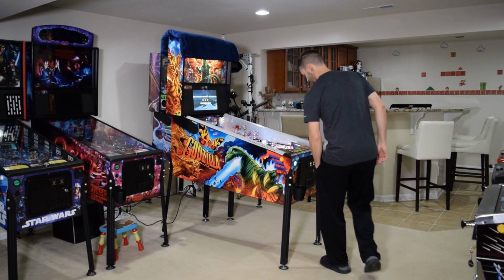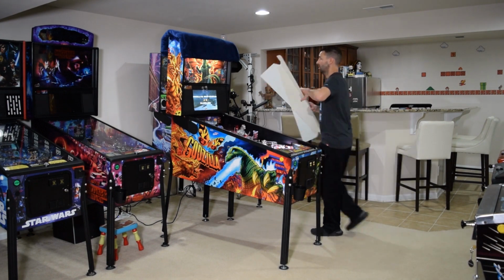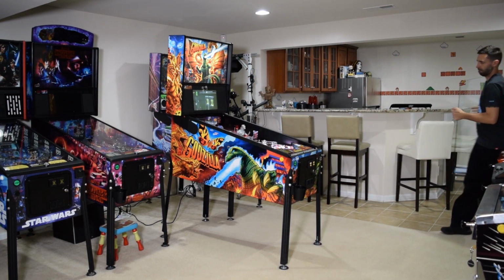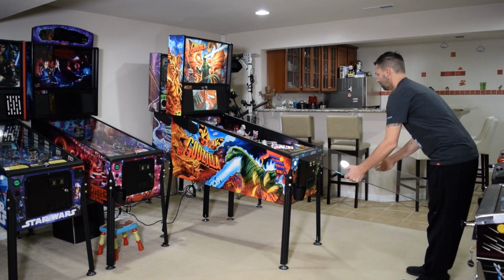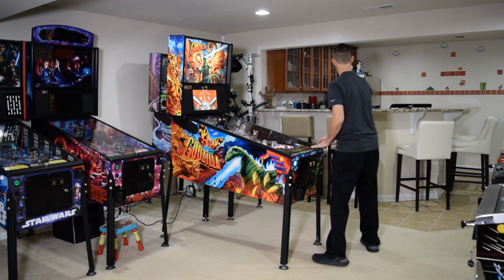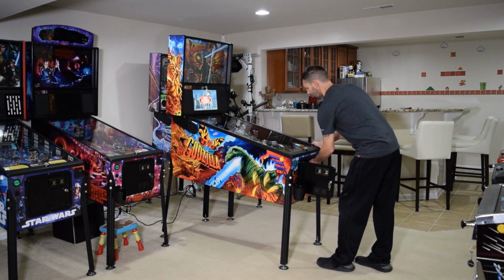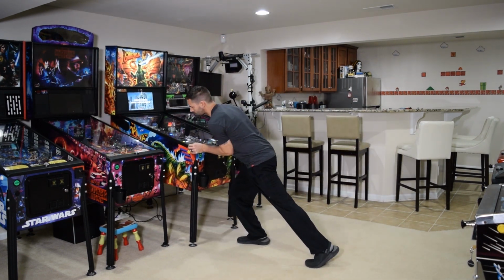If everything looks good, install the pinballs, remove the cabinet protectors and blanket from the back box, install the playfield glass and lockdown bar, then close the coin door. If you move the pinball machine, push it back into position at this time. Be sure to play a few test games to double check your work.